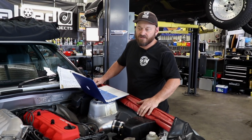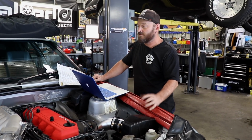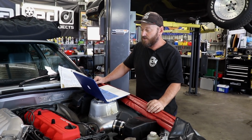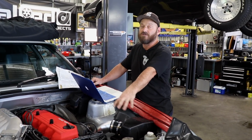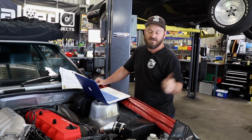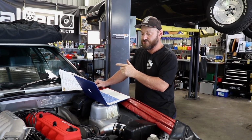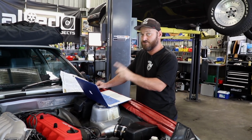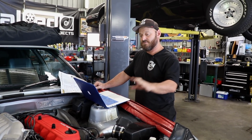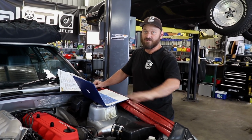We've got everything set up, everything's working. I can hear the idle control buzzing away there. The throttle sweeps through perfectly, temperatures are right. Now what we've got to do is set the trigger angle. Super important. As I said, it will not run if that's not right. So we need a timing light. We need to crank the engine and make sure that the trigger actually is receiving properly, because there will be no timing, there will be no pulsing of the coil if it doesn't receive the trigger.